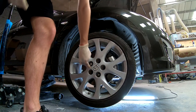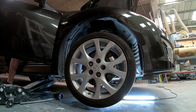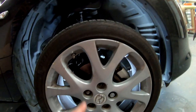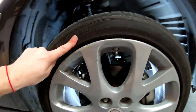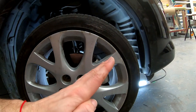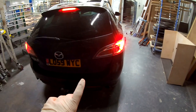This is just a test, that's why not all the wheel nuts are on. So I press the brake pedal and start the car. It spins freely right now — still with one finger. We fixed that problem. Now let's see if once the brake pedal is on the wheel still spins, because it should not spin. The caliper should squeeze together and not let this wheel spin at all.